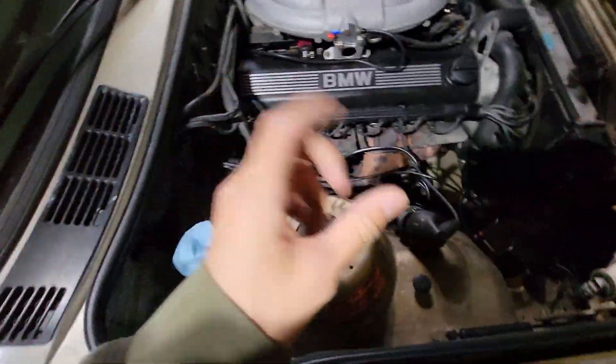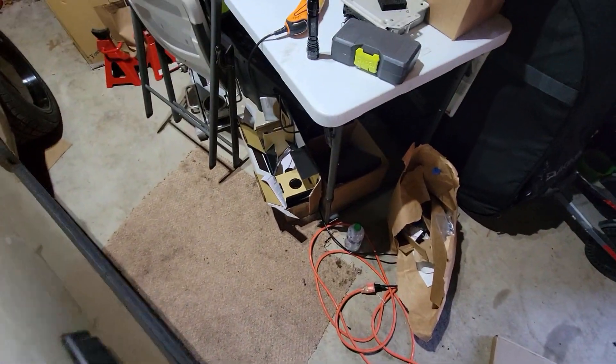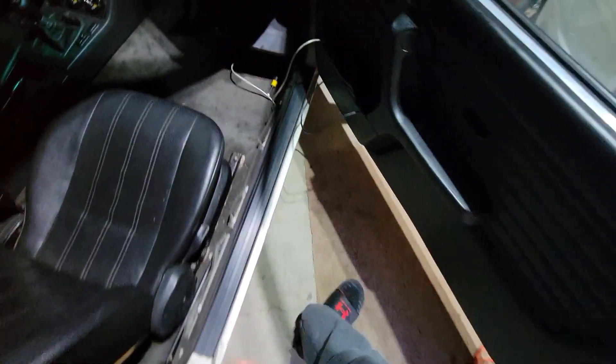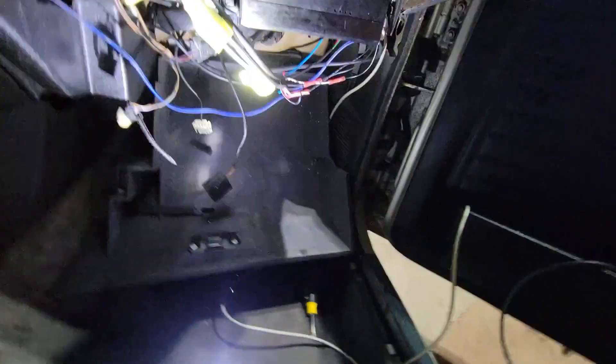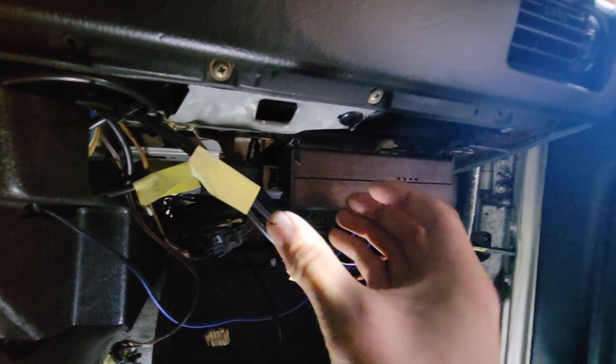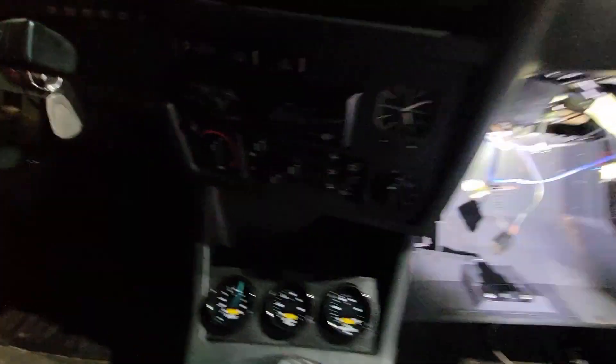I have the banjos that I need now. As for the MegaSquirt, it is now installed - there's the old ECU right there. I have the plug-and-play right here. If you're wondering how I mounted it, basically the ECU cable is on this side - I just rotated it 90 degrees and stuck it back that way, and oriented the wire so it kind of snakes behind the actual computer for the gauges.